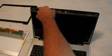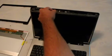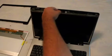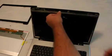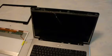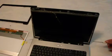Now you want to detach the webcam from the housing. It's just a little bit of a sticky on the back. It's best to start lifting on the left side because of the way it fits in on the right side.